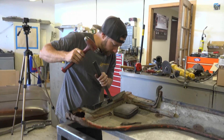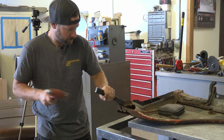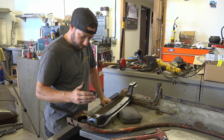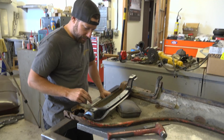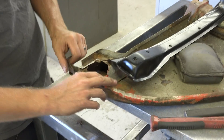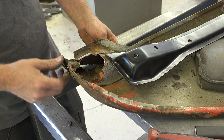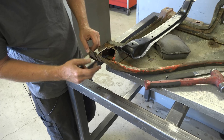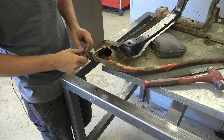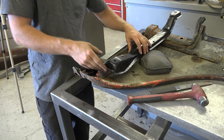I'll trim the firewall again. I think what I'm going to do is graft it right here — I'll probably split it right here. This would be the only structural thing. As long as the side is fine and we can get it in there, I might need to make this piece here on the bottom of the fender, because I don't know if the bottom of the fender will actually be sitting on this correctly.